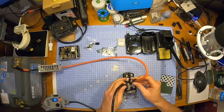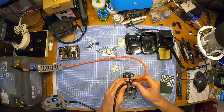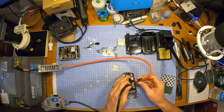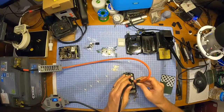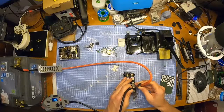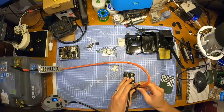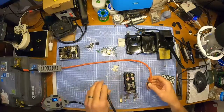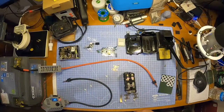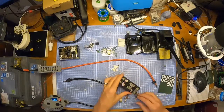I went with the 35E because they were looking for decent mileage. The way I worked it out, it would probably be good for a 1,000 and a 1,500 watt motor. Yeah, I need to double check the 1,500. I think 7p is good for it. Yeah, 7p was good for a 1,500, I think. So that's what I'm doing.